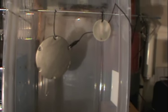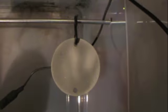Then put it in this oven at 450 for about 20 minutes to get the gases out of the metal. And I let it cool a little bit, clean it with acetone again, and now I'm going to powder coat them. These are both going to be white. Although I keep changing my mind on this piece right here on whether or not it should be that copper color or white, but this here is going to be white, so maybe I'll take this off for now.